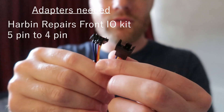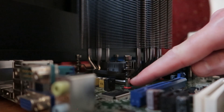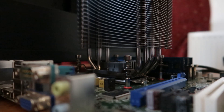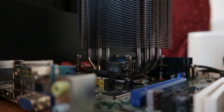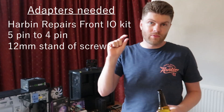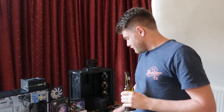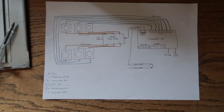To get the fans to work I've had to get these adapters — these are 5-pin to 4-pin. My problems didn't stop there either. I've installed this CPU cooler, and here you can see there's a standoff screw, but this isn't the normal size — it's half the size of what it needs to be. The CPU cooler came with spacers; however, the spacer doesn't come with anything to attach to the back plate, so I've had to find a standoff that plugs into the plate behind. Just like last time, there's been a smidge of movie magic — I've installed the case fans and the CPU cooler, which was very hard because of the whole spacer situation. There are a lot of adapters out there and I've already bought quite a few, so I'm not a stranger to adapters.